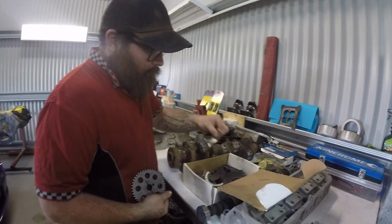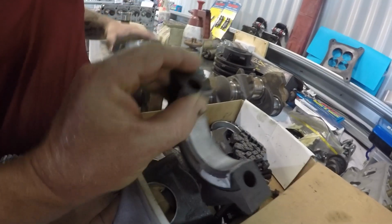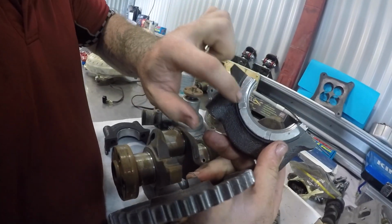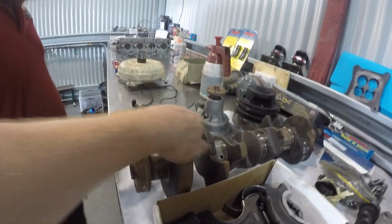So we're thinking. But his bearings are good. Yeah, we didn't find any major issues with bearings or clearances or anything. Everything looked good. Even the crank thrust bearing looked like what they should look like. Most of the damage there is just from it being in the box with the other bearings. But even the crank looked good. Everything looked good on it except for the rockers.